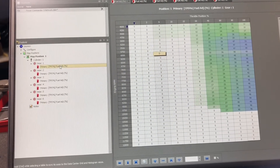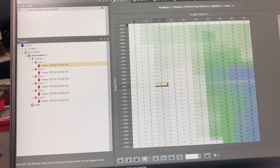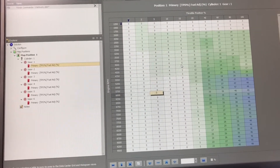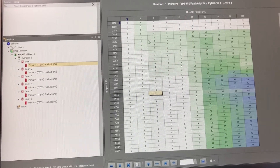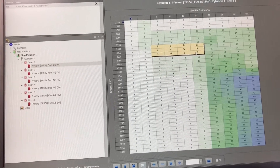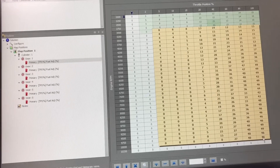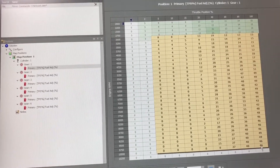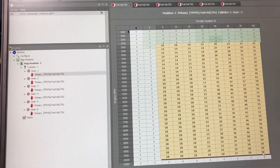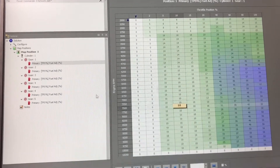The reason for doing this is that these bikes tend to be a little bit twitchy off the bottom — high horsepower. So if you want to soften that up and make it a little more dead, you can come in here and make first gear a little bit richer. I don't recommend doing it at idle, so from 3000 RPM all the way through — highlight the whole thing, come down here, and use page up/page down. I just made it ten percent richer. That's first gear — a little bit softer.